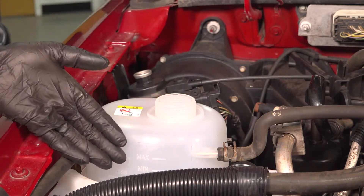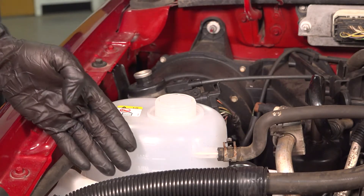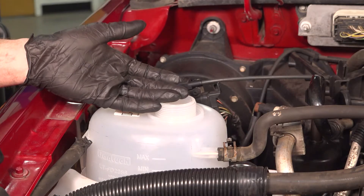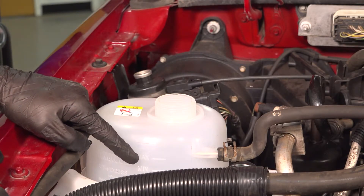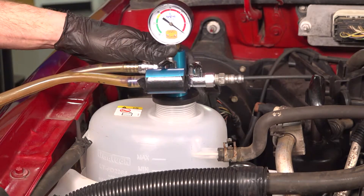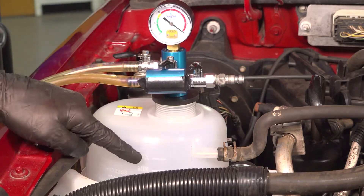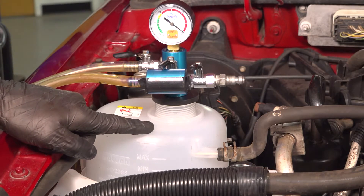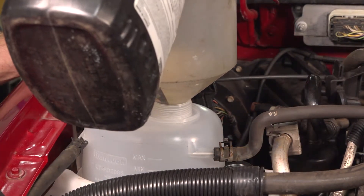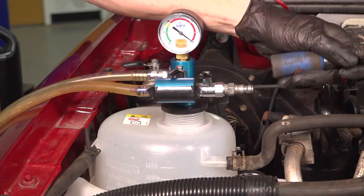As you add coolant, it's going to start making its way down into the system and air will make its way up, meaning the coolant level will continue making its way down. Some people will try to use a funnel to fill the cooling system — just be careful not to go past the maximum line. The funnel is great for not making a mess. If you have a specialty vacuum tool, we're going to make sure that while we're creating vacuum and drawing fluid in, we only make our way up to the maximum line and not past that. We'll be using the manufacturer's specified fluid, making sure that it is mixed.